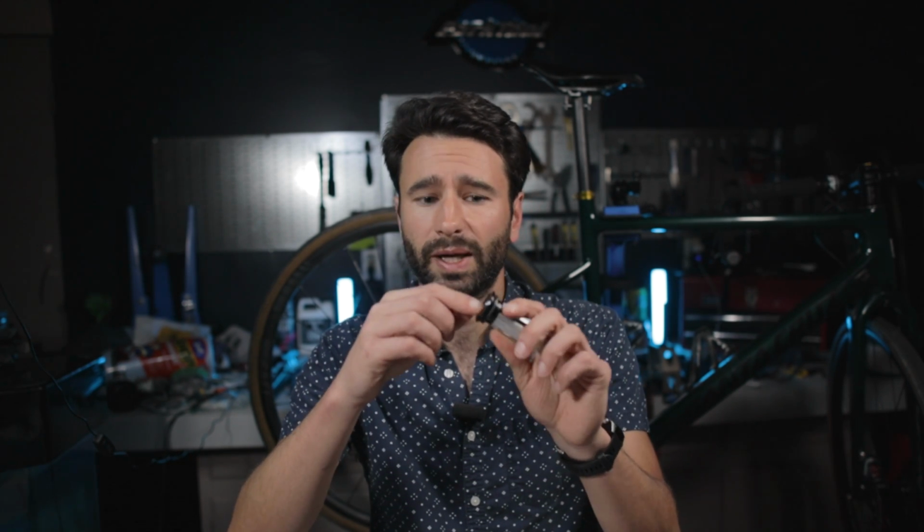The clamp and the capsule are relatively small parts. The capsule was a little bit finicky to install at first because you had to hold the top cap down and then tighten the Torx. It's a little bit different than the standard expander plugs, where the standard one has the top cap but also a secondary bolt within it that you tighten inside the steer tube, and then you just tighten the top cap onto it to set the preload.